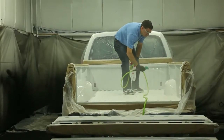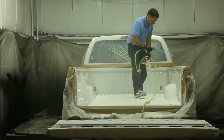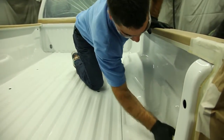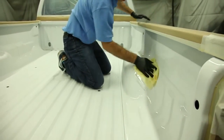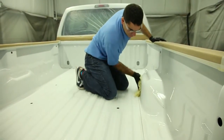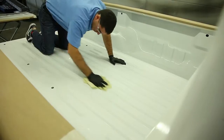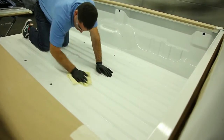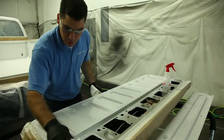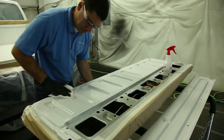Finally, using compressed air, blow all the small particles that may be hiding in the recessed areas of the truck bed. Wipe down the bed with denatured alcohol and a clean rag to ensure the strongest possible bond between the bed and liner. Remember, you should be wearing safety gloves and a dual cartridge respirator during this process. Alternate between the sandpaper and the denatured alcohol to make sure the entire bed is properly scuffed. Perform the same procedure to the tailgate, making sure to wipe it down to remove any dust or debris.